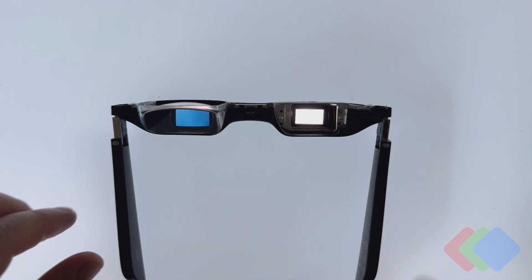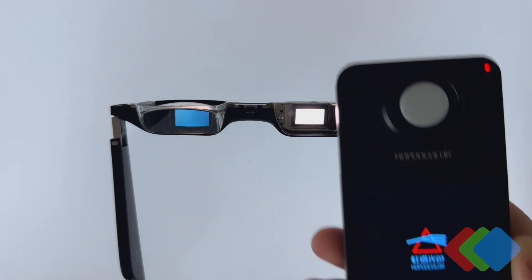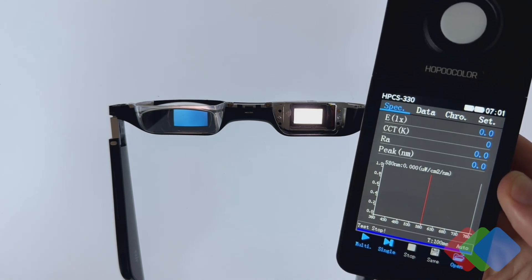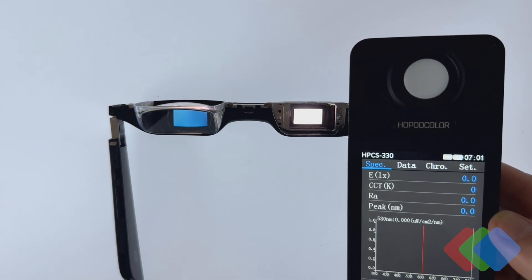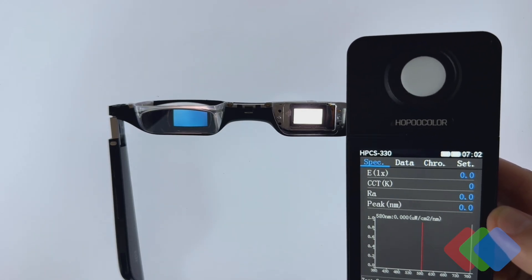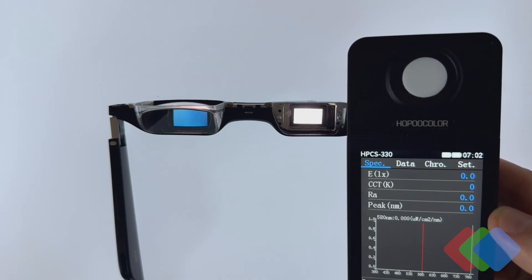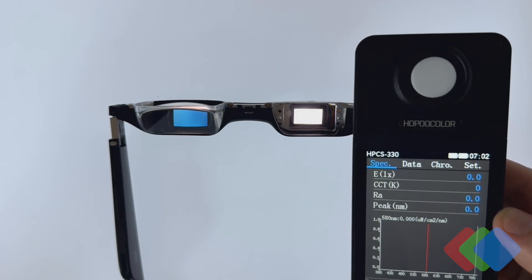This is a very nice way to estimate roughly how much battery life we'll be consuming with our device. Another interesting thing we can do is start measuring the spectral output of the device. We take a spectrophotometer, like the one you see here, which will collect the light output coming from any particular source in this sensing location, and give us insight into what that output looks like — both in terms of strength versus wavelength, as well as overall luminance of the device.